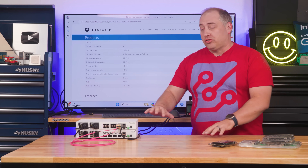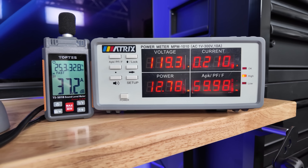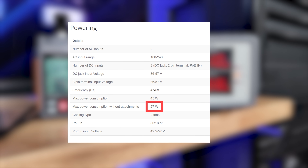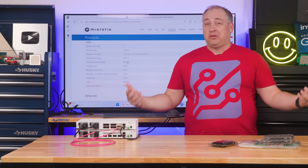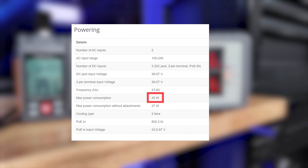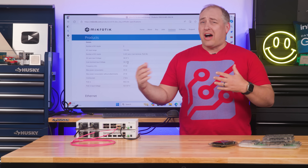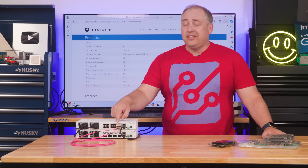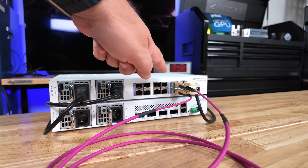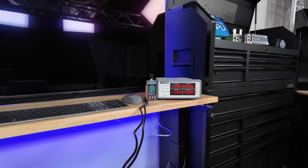Let's talk about the power consumption of the switch. If you just plug it in with no cables, you'll see power consumption somewhere in that 15-watt range — maybe a watt up or down. MikroTik says the switch can go up to 27 watts without attachments — so that's perhaps running the switch chip as hard as you can. The maximum rated power consumption is about 45 watts according to MikroTik, and we got pretty close, into the 40-watt range. A big factor on a switch like this is what kind of optics or DACs you use. For example, these two 100G SR4 short-range QSFP28 modules — plugging them in brings power consumption up quite significantly from that 15-watt range to around 22–23 watts.